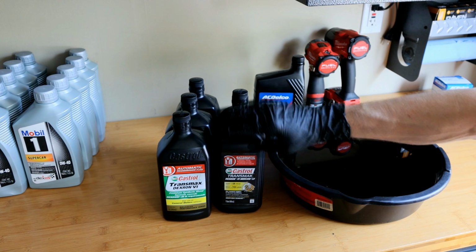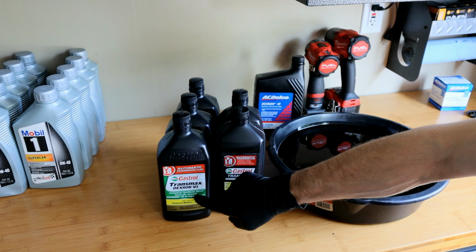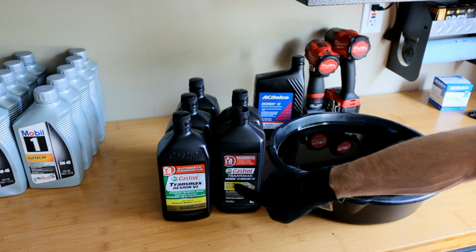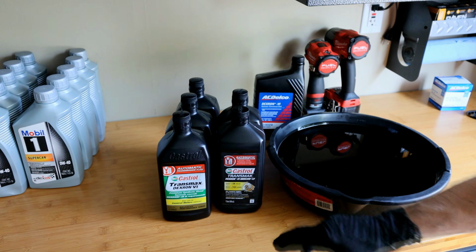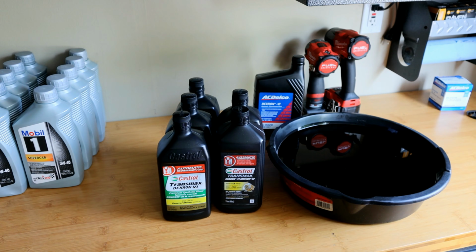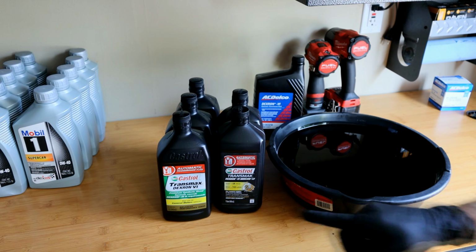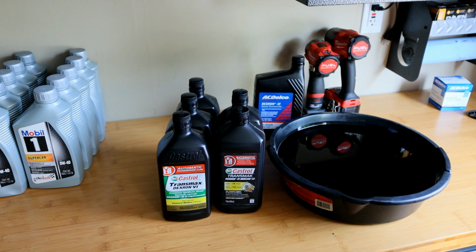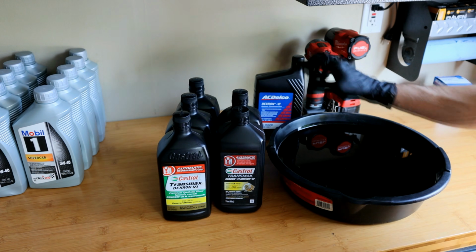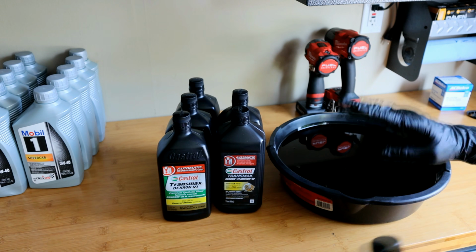The fluid that I've been using for many years is this Castrol Dexron VI. This is their older synthetic blend. I think it was roughly around 2021 where this full synthetic version came out. And this one is also approved for the Mercon LV fluid as well on the Ford. Just make sure whatever version you get that it's an approved Dexron VI and not a recommended. There are some fluids out there that they're not actually approved by GM, they're only recommended. The ones that I've always used, it's always been the AC Delco or this Castrol, and I've had good success with them.